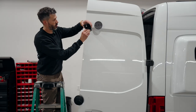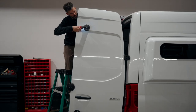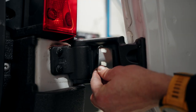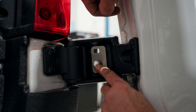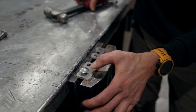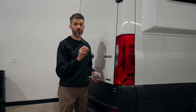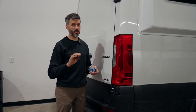The smaller L-shaped bracket is the top bracket. There are two plates — this is the bottom, this is the top one. Now pay attention to the way the bolt should be inserted. If you're not sure, you can always put the plate inside the hinge to figure out which way they go, then insert your carriage bolt. Line up the carriage bolt square with the slot on the plate and close the door — they will stay in place. Note: stainless bolt with stainless nut can cause problems. It's a soft material and it tends to gum up, and trust me if that happens it's going to ruin your day.